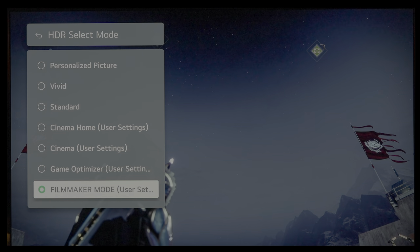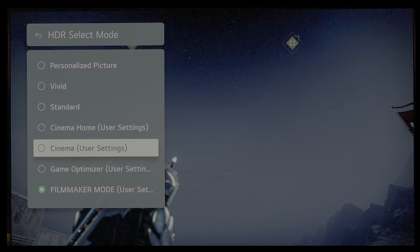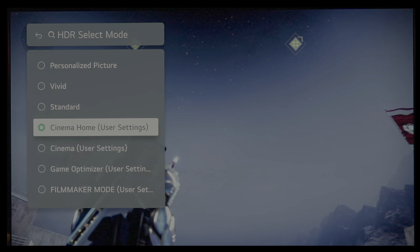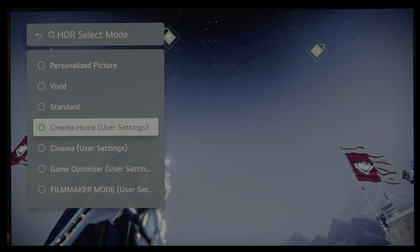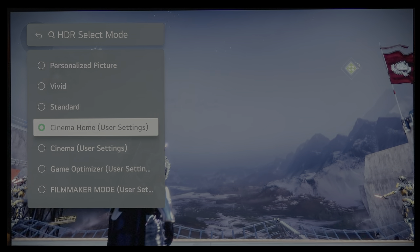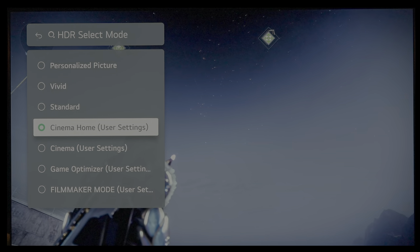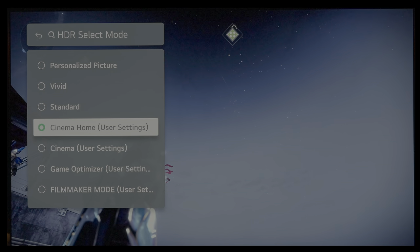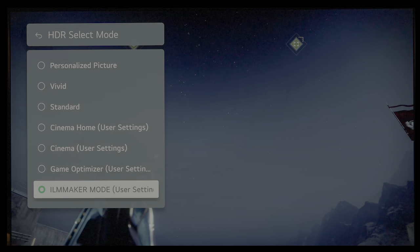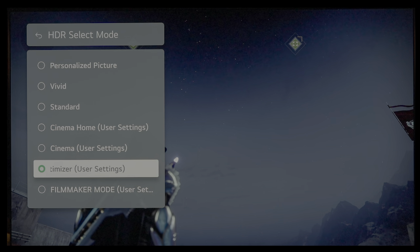Moving into gaming: looking up into skies at 120Hz, color gradient posterization is a clear and noticeable issue — color rings and banding appear throughout the sky. This affects game mode and other modes whenever ALLM is on. The smooth gradation feature does not work in any of these modes when auto-low latency is active — a longstanding LG issue, so don't expect this to change.